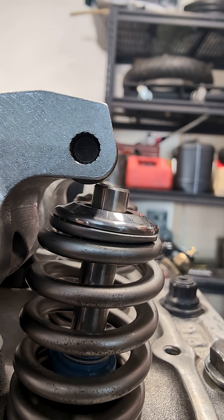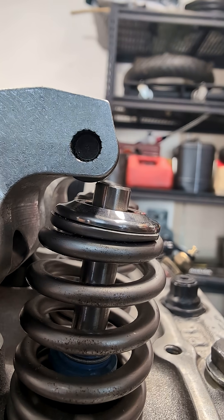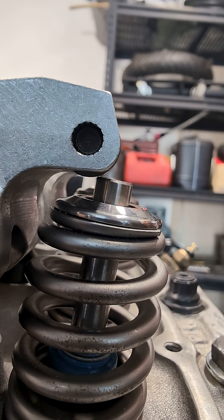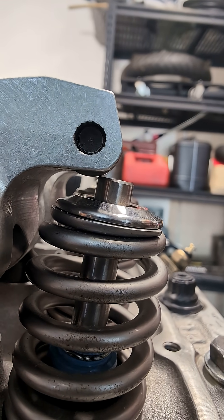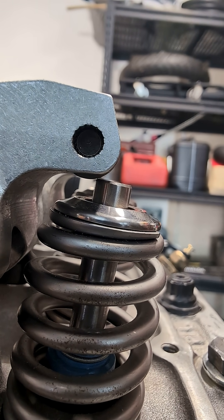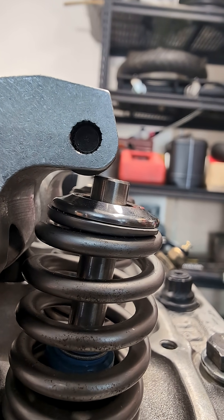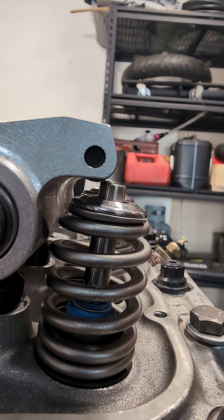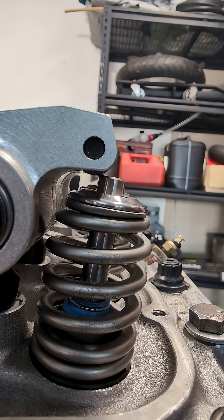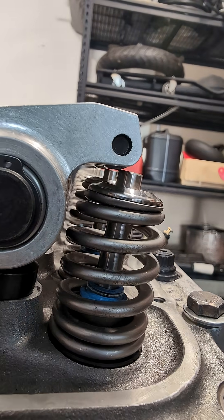As you can see, the center line of the roller is way behind the edge of the valve stem, and it just gets better as you lift it up. That 9 to 10 mil has it sitting nicely on the end of the valve stem and it moves across quite nicely. At 9 mil it wasn't quite central, but at 10 mil I reckon it'd be getting close.